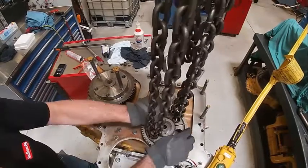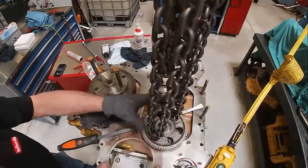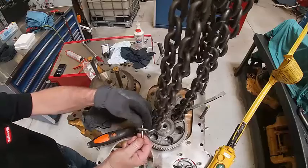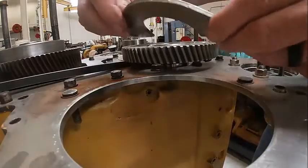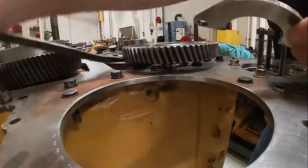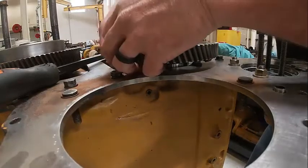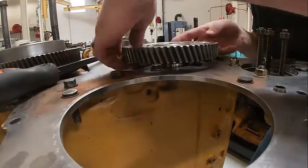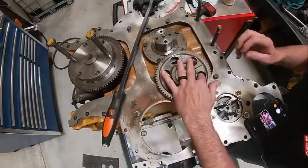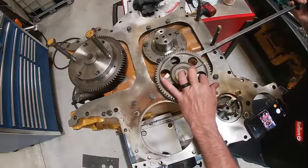Now I'm in and I'm started. I'm going to leave it up just a little bit and put something underneath it so I can get my nuts out of there. I just put some thick washers and a bolt through the chain like that. Okay, this is the thrust bearing for the camshaft — it can go in either way, I usually put the part number out. That manages your thrust, keeps it from sliding in too far. You can see the thrust bearing down here — that keeps the cam from sliding back and forth too far. I'm going to line those holes up there.